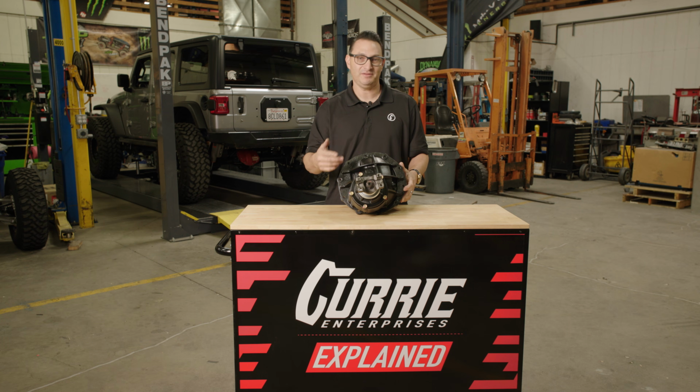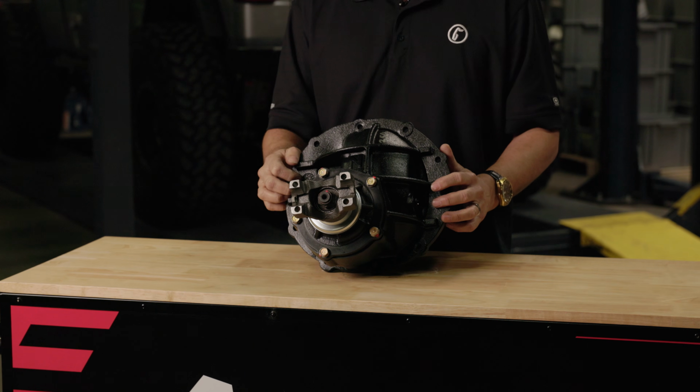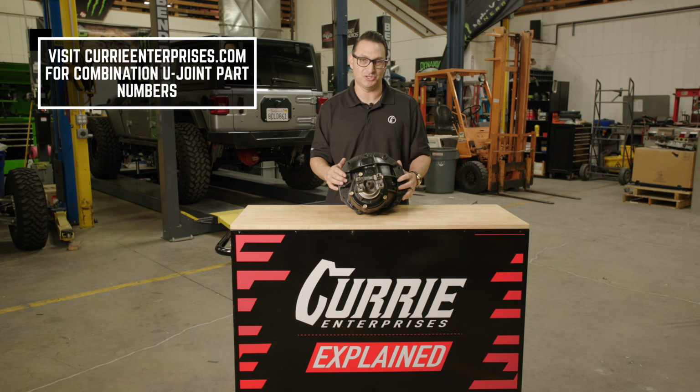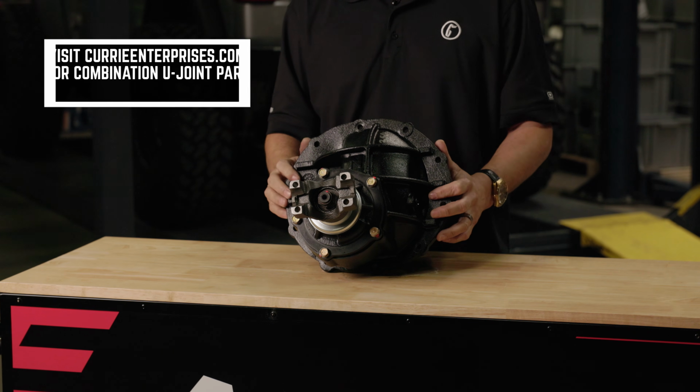Reason being is, one, you talk to your drive shaft manufacturer, everybody across the aftermarket knows what a 1350 U-joint is, so it's easy to make a drive shaft for, and it's easy to adapt to if you use a combination U-joint. Combination U-joint part numbers are available on our website under our tech area.